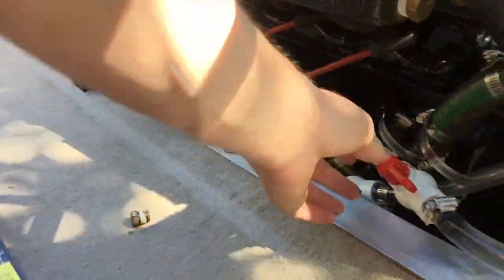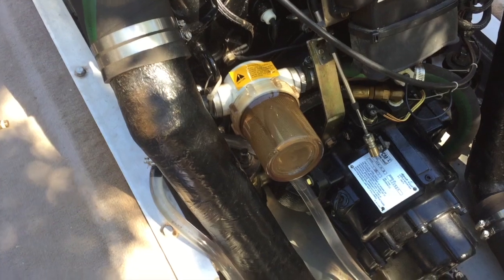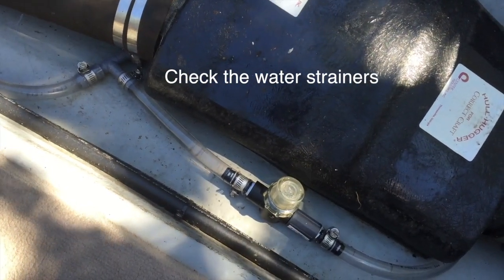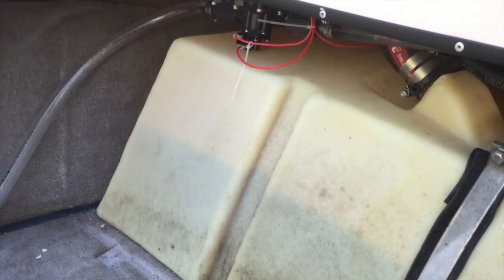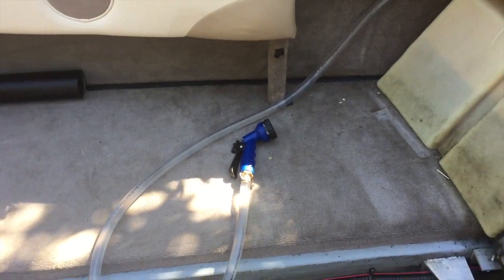What you want to do is fine-tune these valves over here. Make sure the valves are set the way you want depending on how hot your boat runs and how hot or cold the water is — you'll have to adjust these valves. Just like you clean and check this filter regularly, you should also be cleaning and checking this filter as well, even though it's after the other one. Everything looks like it's running and not leaking. The pump turns off at 50 PSI which is very nice. If I want to I could get a longer hose to go in the back, but right now it works out pretty well.